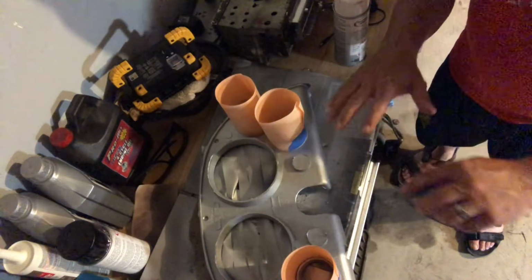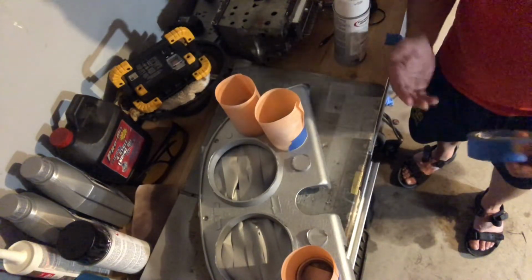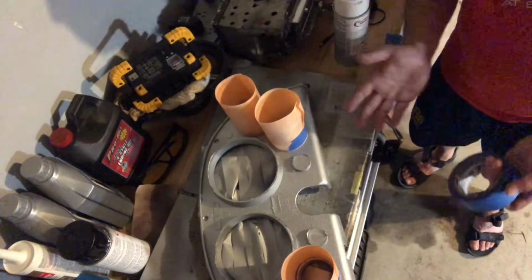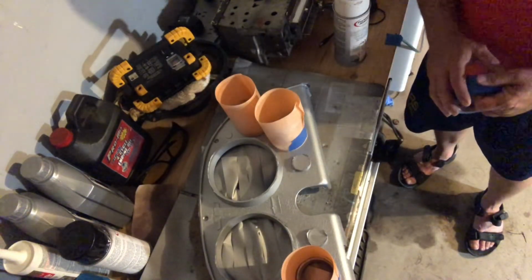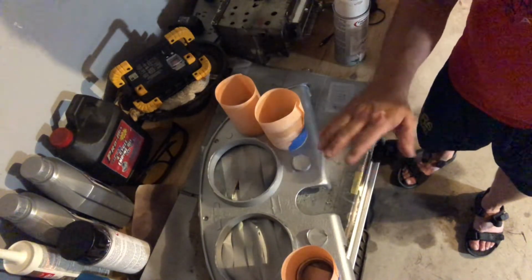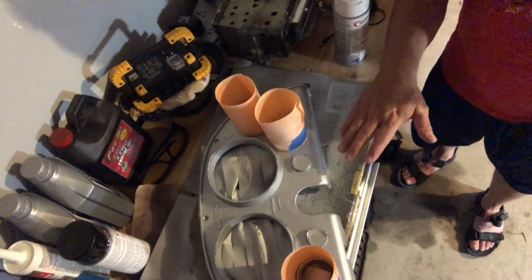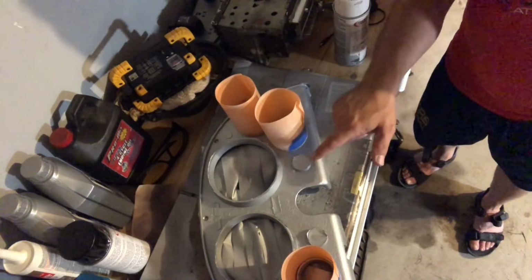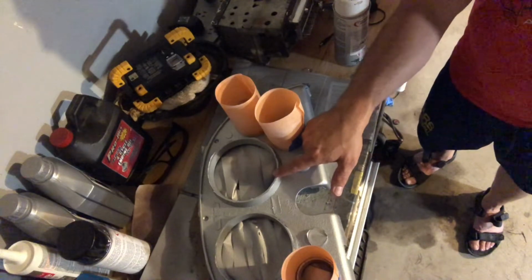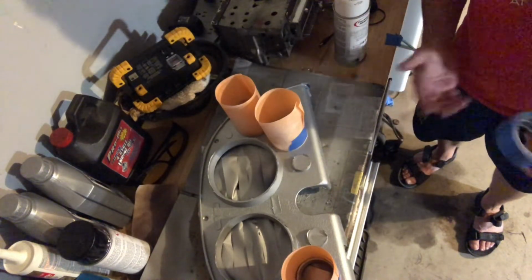And when you strip all this, which is the first step, to strip with paint stripper the paint down to bare metal and then paint it back up by layers, you'll find that the whole thing is chrome to begin with. But in the '63, it's unique because it had frosted rings around the gauges with the accent being chrome. And you want to reproduce that.